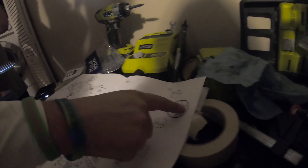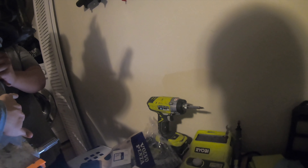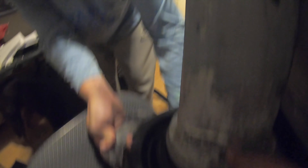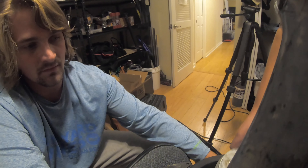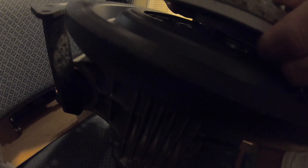It goes like this on the boat. See the prop? This goes directly parallel to the prop. If all the bolts fit, then maybe that's the way it's supposed to be. Just double check to see if the bolts fit in the bottom. We've got to do it in a specific sequence — that's what the diagonal pattern is for. You have to tighten them in that sequence. You'll be able to tell once we flip this over — the two and four are in the middle.